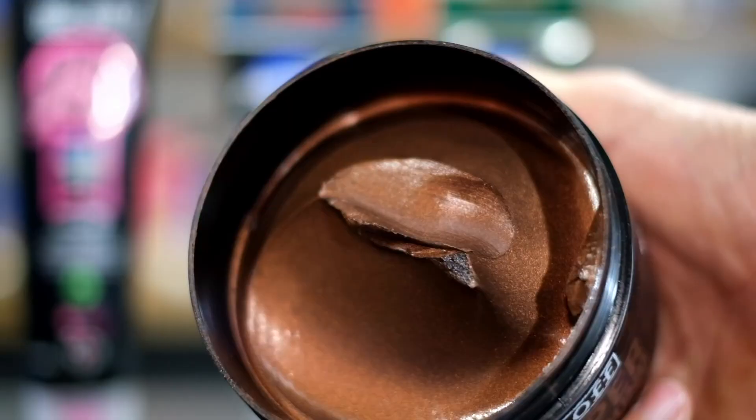If it doesn't budge, try a freeze and penetrant spray — penetrating oil basically. Spray it on, leave it overnight, then try again. It should work its way into the threads. It might have been a while since it was adjusted, or knowing it's a trials bike where chain tension is critical, it might have been cranked up ridiculously tight and got stuck. If so, learn from that — use decent grease or an anti-seize, something like a copper compound, so it goes on and comes off easier next time.